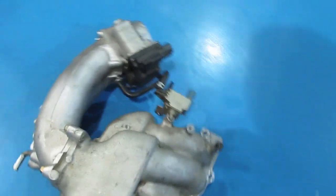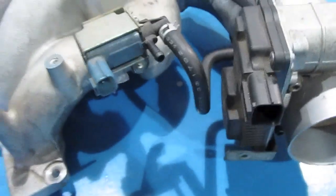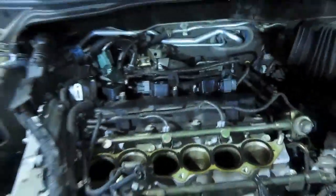So you can see everything that had to be taken loose to get this contraption off. And that really helps because I've replaced these. I replaced the spark plugs in these and left the old coils there. I put new coils in here and not here yet, because these are so easy to get. You can change them anytime. You want to go ahead and put new here and here and here. Just save yourself a world of trouble.